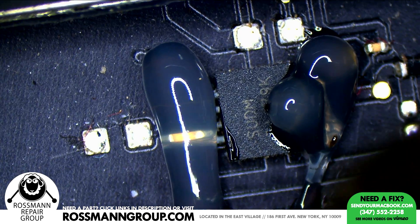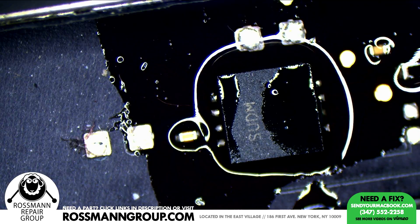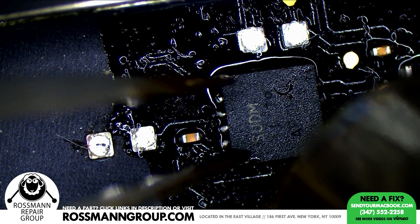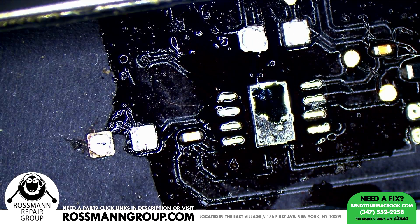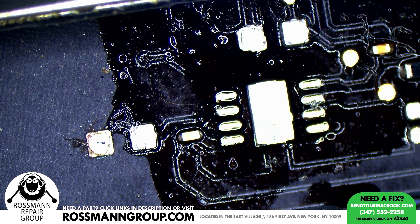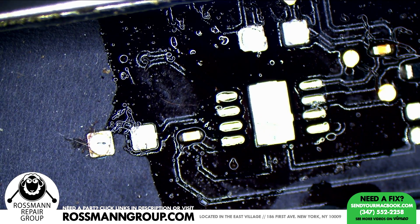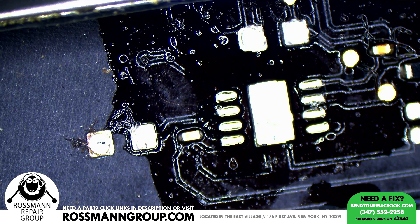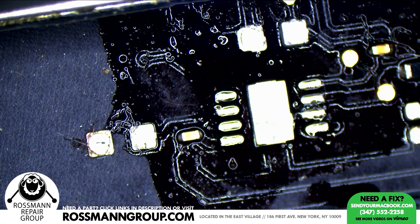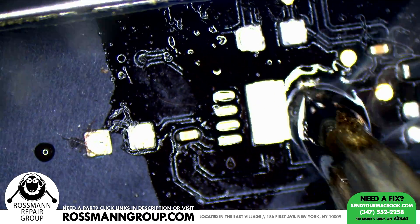Let's see if we get a green light once we remove this chip. Remember, it's still not going to work when I remove this chip, because the whole purpose of this chip is to hold SMC Reset L low for the first quarter of a second after the machine turns on, so that the SMC doesn't crash. The SMC runs off of PP3V42 — that's the first power rail that becomes present. However, while that power rail is being created it's going to be jumpy, and if the SMC tries to boot while PP3V42 is fluctuating, it's going to crash. So we keep it from crashing by holding it off until PP3V42 has stabilized. This is kind of like a brownout detector chip. But at the very least it will allow me to see if SMC Reset L is high — and if it is, I'll know that removing this chip was the fix.